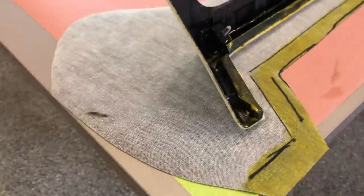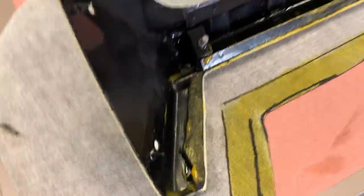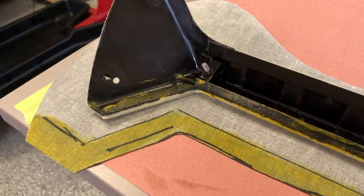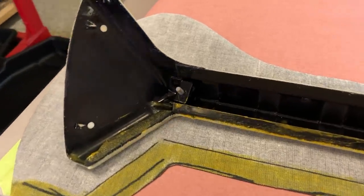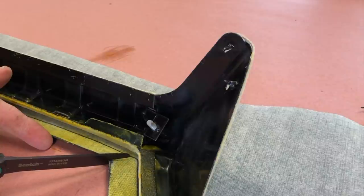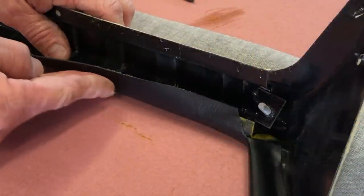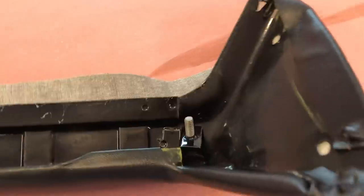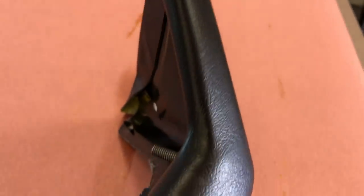Next I'm going to take the leatherette outside and let it warm up in the sun for probably 10 minutes to get it nice and hot and supple. Bending this inside corner is going to be real tough when we pull it around on this shape — it's pretty thick material, thicker than the original — so we're going to wrestle with that a little bit. The softer it is, the better it'll go. After about an hour and a half in the sun, I've successfully wrapped the top section and took it back to the car to mock it up to make sure everything's going to work with the dashboard.